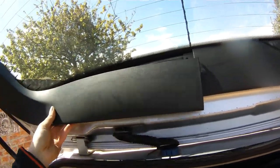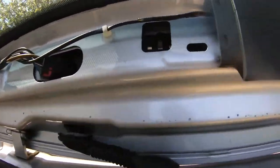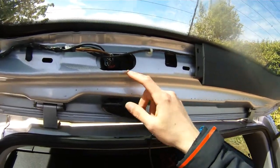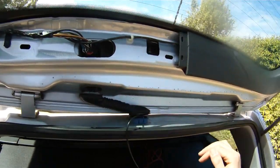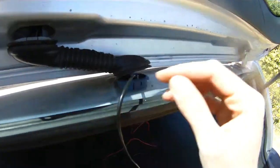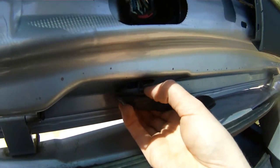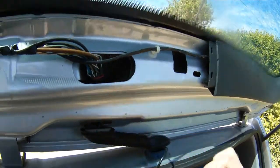We're making good progress now. This panel here — if you put your fingers under and pull gently, it will unclip. That gives you access to the wiring. The plan is to bring the camera cable up through here and mount the camera internally. To get the wire this far into the wiring loom in the boot lid, I've pulled down on here — pulling down actually unclips it — and fed the cable under, up, and through. To get into these covers, you'll see on the rubber they have little arrows; squeeze the arrows to push the clips down and they disconnect. The next job is to get the cable up through and into the boot itself.